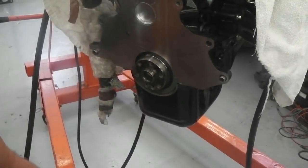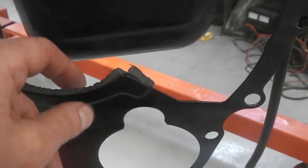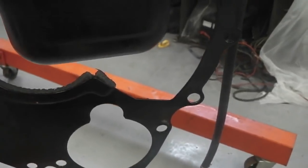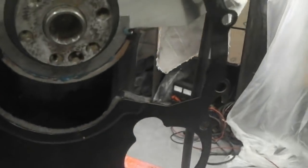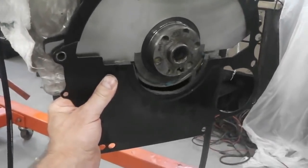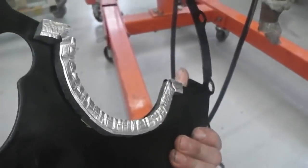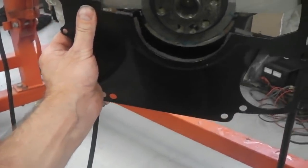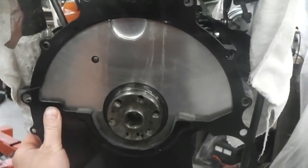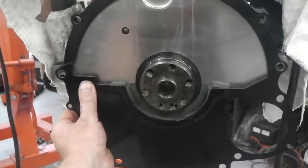Let's get that clutch plate and dust cover done. Here we go. Here's our dust cover, dust plate, sandwich plate. It's powder coated, so a new foam pad seal on the other side of it fits in a recess. Then we line the tabs up. And our dust pad goes on, our sandwich plate goes on with the foam sealing strip. You can just see that there, new strip. I'll flip it round. So new foam sealing strip on, and that's ready to go. So we're going to clip that in place now, and then we'll get this flex plate bolted on.